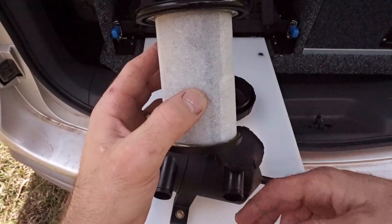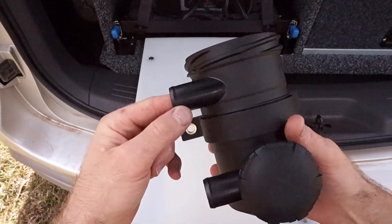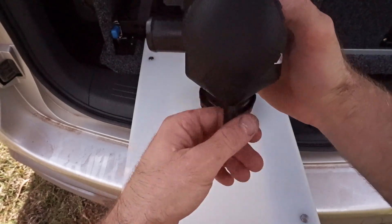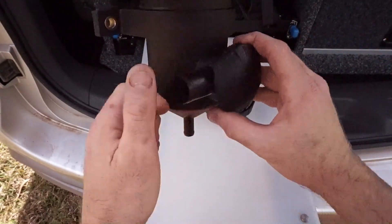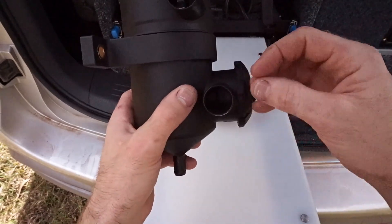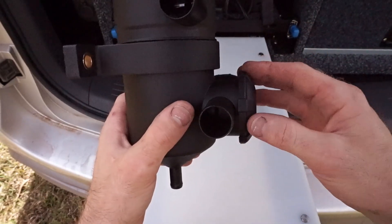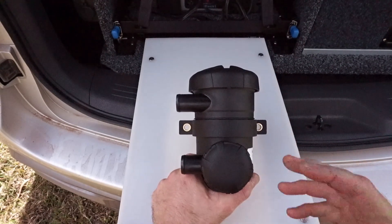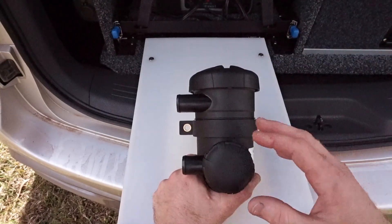The air is separated and comes out the outlet — there's a little arrow pointing out — and that goes back to your intake as clean air. The catch can also has a pressure relief valve in case the system over-pressurises, relieving into your intake so you won't have any seals blow out or oil leaking due to excessive crankcase pressure. Now I'll show you how your PCV system currently works without the catch can installed, and then how it will operate after we install it.